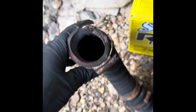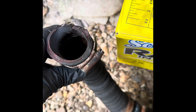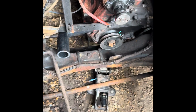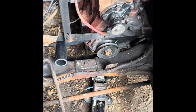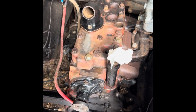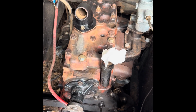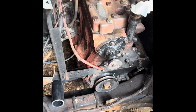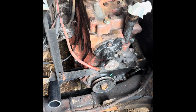We've managed to get it to seal up previously with this flexi hose. As you can see, it had to be squashed quite a lot with that clamp to get it to seal compared to the bit that goes on the radiator. So I'm really hoping that that will fit and I don't have to put the flexi hose back on. For up top, there's nothing that you can buy on the shelf, so that will be a new bit of flexi hose hopefully that goes on there. So yeah, we're getting close now. Let's start bolting on some other bits and pieces.